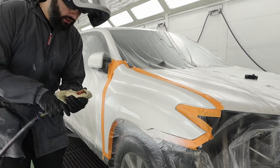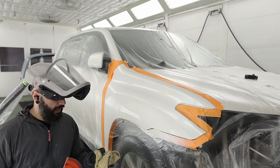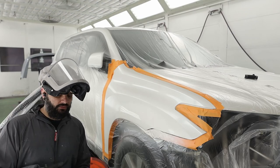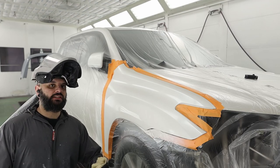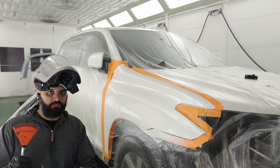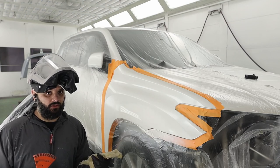This is kind of a side note, but anytime I use any kind of blower, I have a tack rag in my hand all the time. I'm really picky about how clean my gloves feel — I want my hose to be tacked off. It just leads to a cleaner paint job. This is one of those habits I like to pass on: keep a tack rag in your hand, tack everything as you're going — it's going to lead to cleaner work.